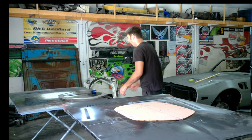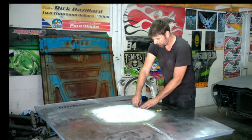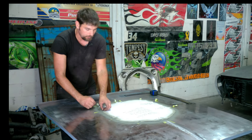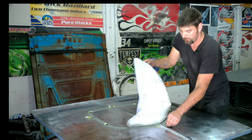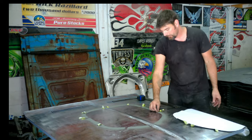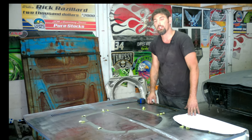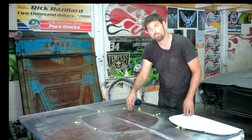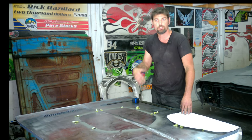Let's go back to this hood right now and take off the paper. What I also did on this trim ring — I actually used spray paint instead of tracing it. I think that line is going to be a little bit crisper versus tracing. I don't trust paper templates — you can kind of push them in when you're tracing. We used some self-etching primer and when we get ready, we'll take it off. That gave us a really good template. I'll connect the dots here and there — a couple spots where I painted over the tape. Before I do cut this, I'm going to flip the hood and take a look at the inside bracing. I think the inside bracing is going to be easier to cut first, and then come back and cut the outer skin so we're not trying to fight bracing and glue.